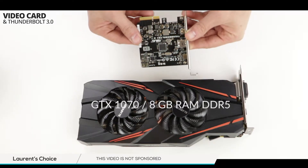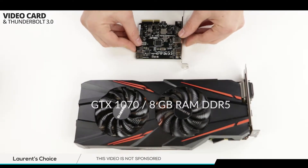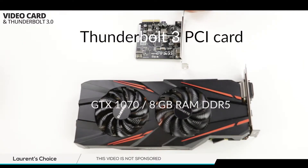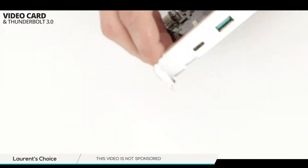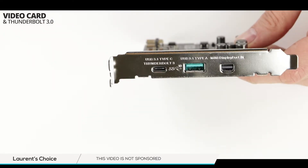The second PCI peripheral we are going to install today is the Thunderbolt 3.0 PCI card from Asus. This PCI card is completely optional, but it will allow us to have a backup 4K display as well as ultra-fast Thunderbolt 3.0, USB 3.1, and Type-C inlets which can transfer data up to 40 gigabits per second. This PCI card requires a double connection to the motherboard — one through the PCI slot and the other through the Thunderbolt header, connected via a direct cable link.